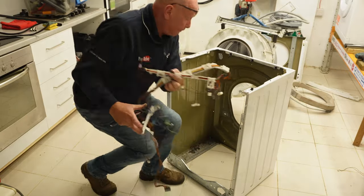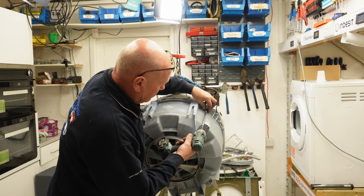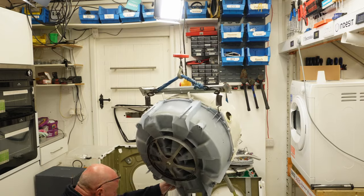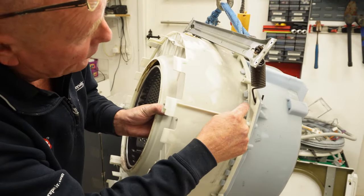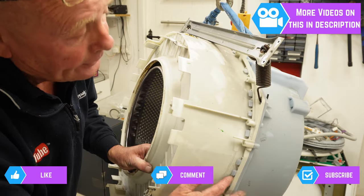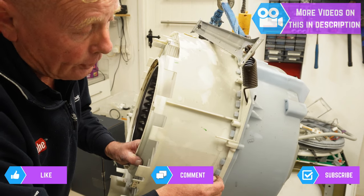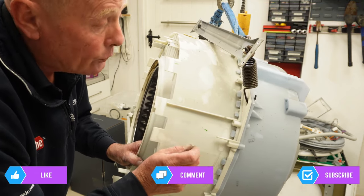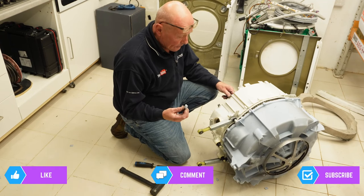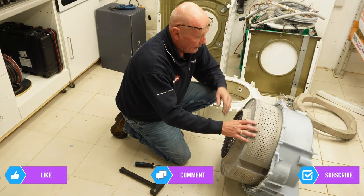And there we have a complete wiring loom. I have done a detailed video on how these drums come apart — firstly you have screws all the way around. Then I'm going to split the drum. You see these plastic lugs — these are the clips that hold it in place. They are designed for a one-fit, but if you see my previous video on how to replace the bearings, you are able to cut these off and then insert a couple of additional screws with the bearing assembly. There are about 20 of these plastic bits that you have to break before you're able to split the drum. Here's the drum.